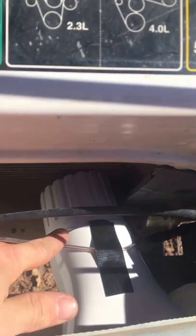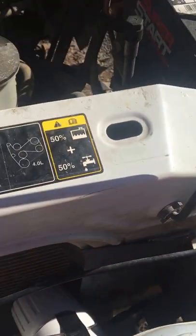The grill comes back and has two little clips down there. The wire is in parallel — two positives together, two negatives together — ran to one channel on the amp. Same for the other side: two positives together, two negatives together, ran to one channel on the amp. That'll knock both of them down to 4 ohms, pushing about 53 watts at 4 ohms per horn.